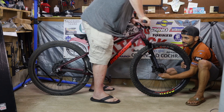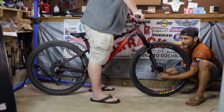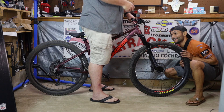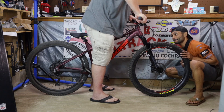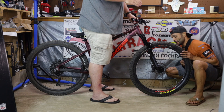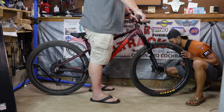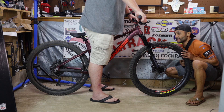Going through the rebound clicks - one off fast, two off, three off, four off fast is probably the sweet spot, and then full slow. Adjustability is good - it doesn't have a ton of clicks but each click hits a sweet spot. You'd probably ride it around three or four clicks off fast. When I get back to riding we'll do a full rating on this fork. Budget-wise it falls in the $201 to $400 range at around $210. That was the install on the Ardor - now let's get to mail time.